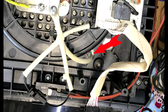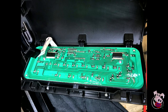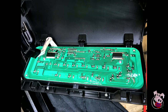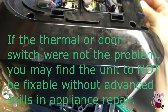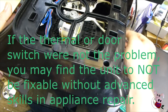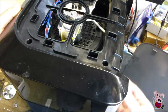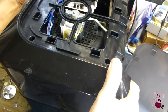I would suspect components like the thermostat — maybe it was reporting a lower temperature than actually existed in the oven. It could be that the logic board told the relay to turn off the element and the relay didn't respond in a timely manner, allowing the temperature to rise too high. Another possibility is the logic board wasn't working properly, or there could be an element problem. If your thermal fuse trips again, you need to find the source of the issue. If you heard the click and went from no continuity to continuity on your thermal switch, you can proceed with reassembling your unit for testing.